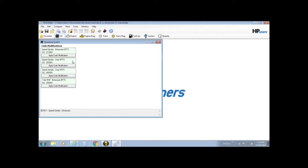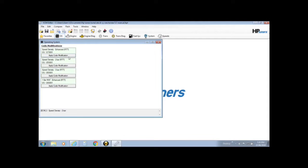Another thing to note: if your car has already had a MAF-less tune or something like that, more than likely it's had a Speed Density Enhanced operating system put in there. Once you've got that in your programming, you can't change back from Speed Density Enhanced to Speed Density 2 Bar. You need to reload or have a standard tune — the first one you got — and then apply, restart, and then apply your Speed Density 2 Bar. I learned that the hard way; it took me a while to figure it out.